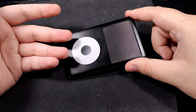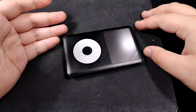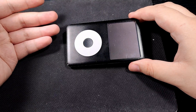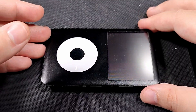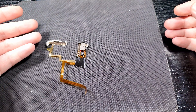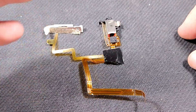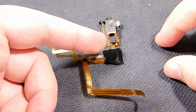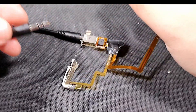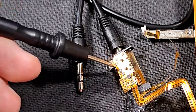This is what I had to say about the case itself, but the whole reason I started this project was another one. I bought the new iPod and did the whole swap and all this just to replace the headphone jack - and I have bad news. It turns out this thing is broken. And yes, I do feel like an idiot for not even checking it before I did all that. What I've been able to find is that the jack itself seems to be just fine. However, this flex cable that goes to the motherboard has a break in it somewhere. We can test this by plugging in an aux cable - each of the segments we can see on the headphone jack actually connects to one of these points on the back.